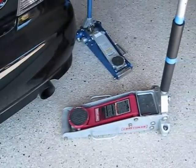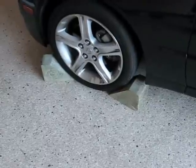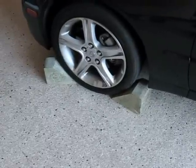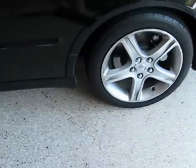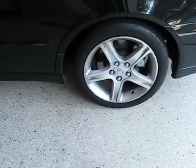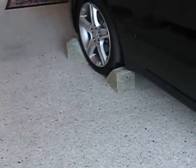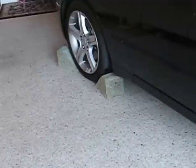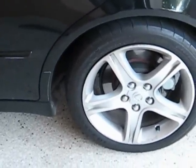Let's put some chocks under the front wheels. We're going to do the back first. Once the back of the car is up in the air, you haven't got any parking brake anymore — it's a rear-wheel drive car and you haven't got it in gear anymore. So you do that for safety. I doubt it would go anywhere — I have jacked up a car without using that and it doesn't really go anywhere — but just do it for safety.